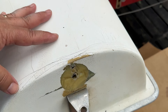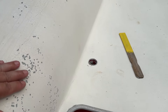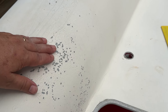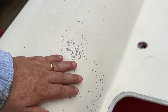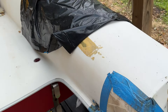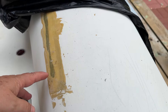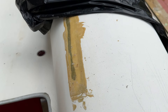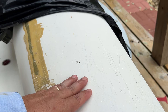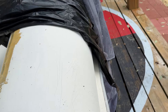These are some stress cracks from the gel coat being old. I have to look at this closer — I can't tell if it's a prior repair or just old gel coat. We'll sand it down and get some more gel coat on there. I'll probably go with the gel coat since it's the right material. Sometimes you just get it all patched up and then paint, but I think this boat, since the fiberglass is so thin, it needs that extra thick gel coat on there.